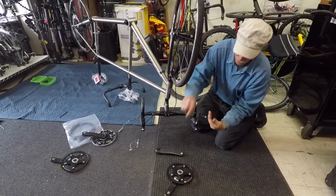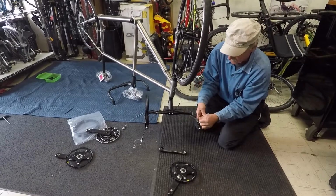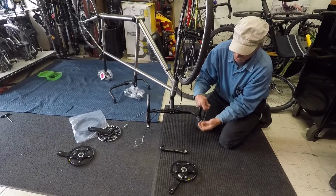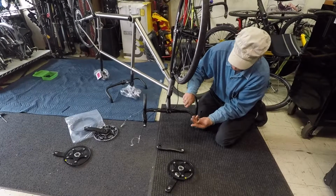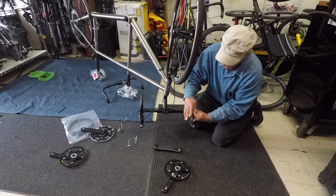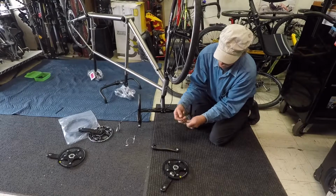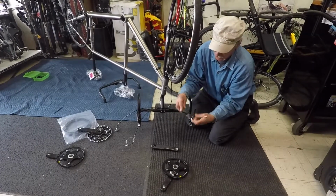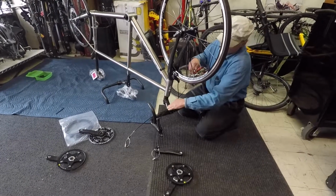I will go through a rolling procedure now too. Put this all the way in, wrap it around your fingers, leave about 8 inches out, and loop it several times, and it will hold itself together, okay? Again, don't start doing it at the beginning, but wrap it 3 or 4 times, leave about 8 inches, get your housing as close in as you can, 3 or 4 times, and then the end swivels in like that, and it holds the cable intact. Makes a neater package when you're packing the case.